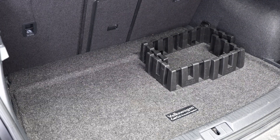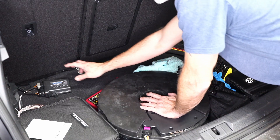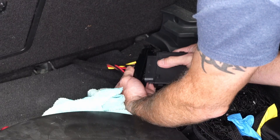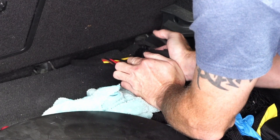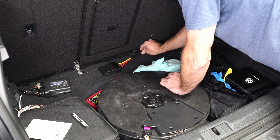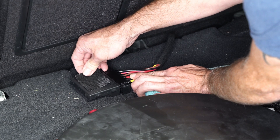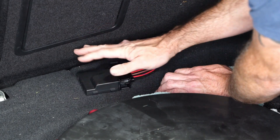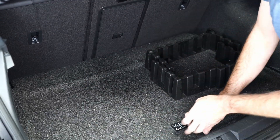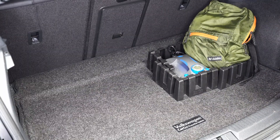Now we're going to the back of the vehicle and going underneath the rear floor. I already have a Haldex controller back here, so I'm just going to do the same sort of thing with the new EQT brushless fuel pump controller. Connecting the controller to the harness and laying it right here. Because I have carpet, I'm going to use Velcro — the same thing I did on the Haldex controller — cut a little piece to fit. That makes a nice way to keep things in place. When I put the floor back on, you'll never see any of those wires. The control module is going to get hot, so you don't want it really tucked in anywhere, but there's enough room to get at least a little bit of airflow and heat dissipation.